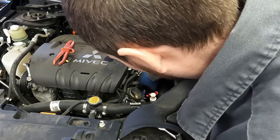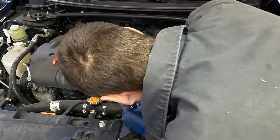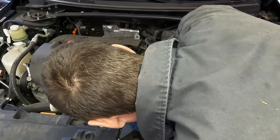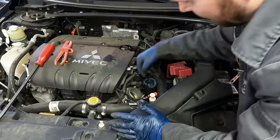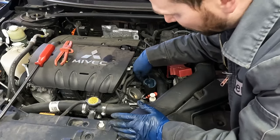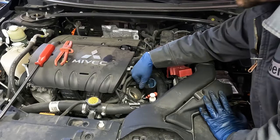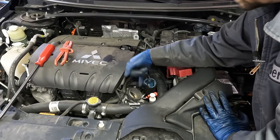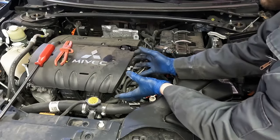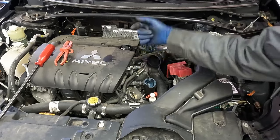I'm going to buzz this out. Make sure I'm not backing into something and can't get my ratchet back out. My electric ratchet got a little trapped because of where that bolt is — it came out a little too far, so the head of my ratchet is tucked up against the bell housing of the transmission. No big deal. Let's go underneath and get that bottom bolt for the starter off. As the starter moves, that bolt will move as well to give us more room to pull this out.